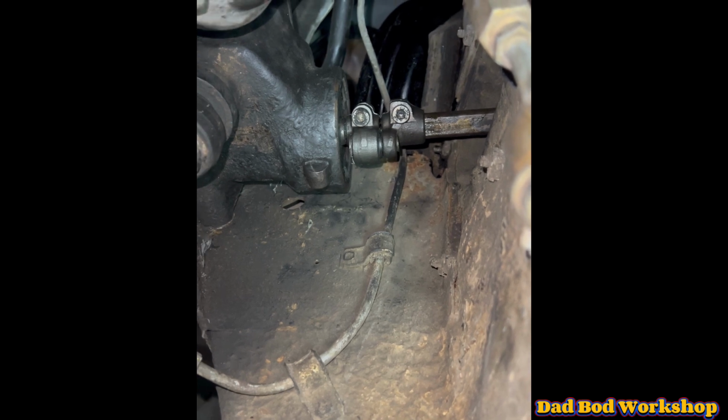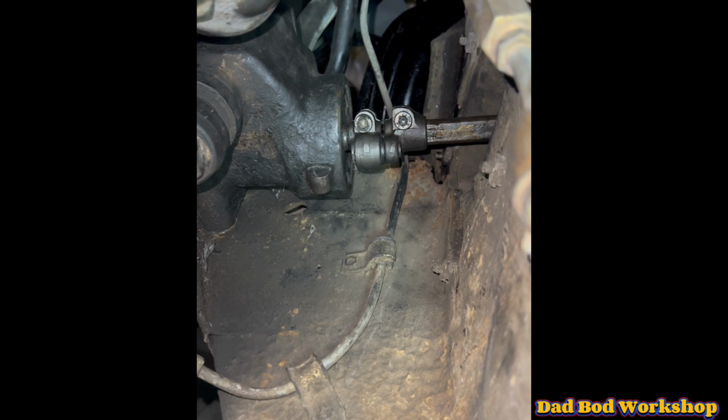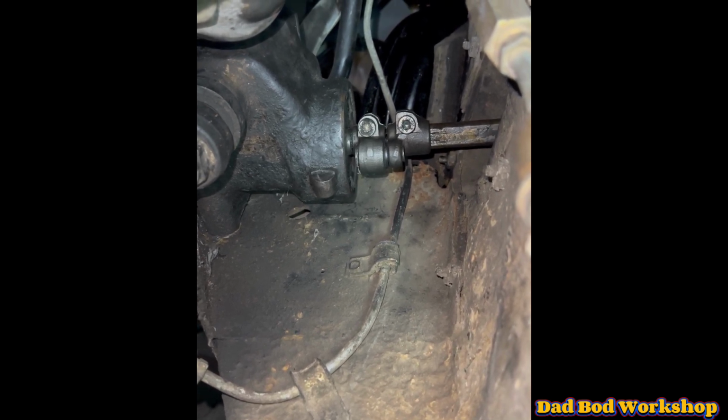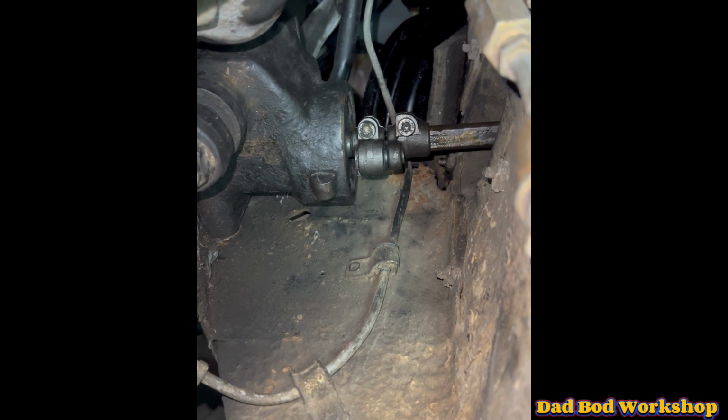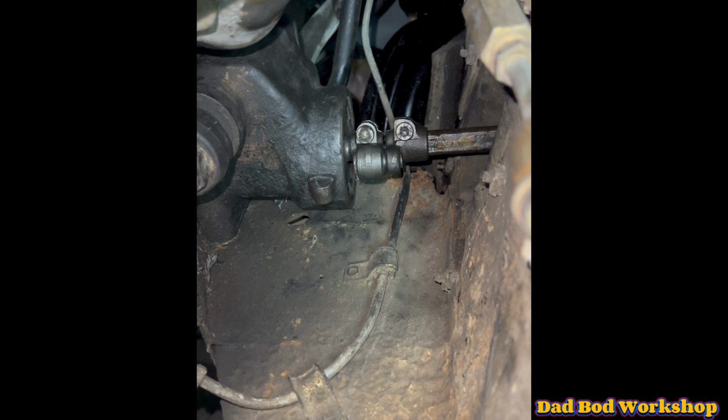The only way to get them together is having the steering box very loose after the 3 bolts have been taken out, as we've previously discussed, and then you need to have them end on end in a certain position and force them together at a certain angle. It's a horrible job, but that's the only way to get them actually together.